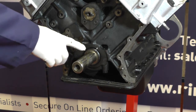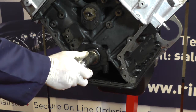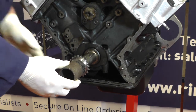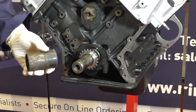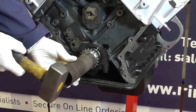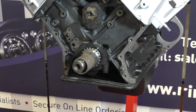We've made sure the crankshaft is all nicely clean with no bits of dirt or muck, and we're going to fit the sprocket on. Make sure it lines up with the keyway and push it on so far. Then using a bit of tube that fits nicely over the keyway, gently tap it on. Use an extra bit of tube to tap it all the way snugly down to the end. You'll notice when it hits the other end because the tone of the knocking changes. Next we need to make sure this is in alignment with all the other sprockets.